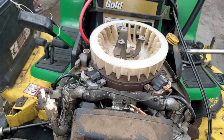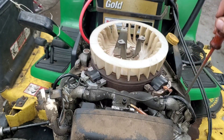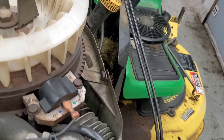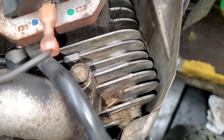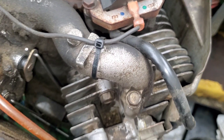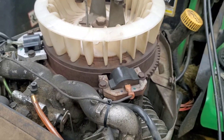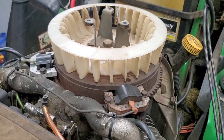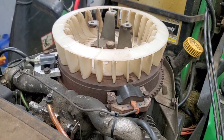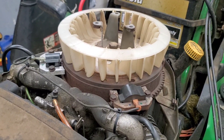So basically, mice got in here and chewed it all up, ruined all of this stuff. Make sure you get it all cleaned out, especially the cylinder head — you don't want the cooling fins packed full of debris. Get those all clean of grass and stuff, otherwise you'll get overheating issues over time. That's how you fix an engine that's bogging down in high grass or not running right with not enough power. A lot of times it's just a bad coil or wiring issue caused by mice, rats, anything in that general nature. Thanks for watching — like and subscribe.